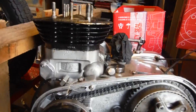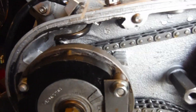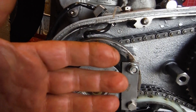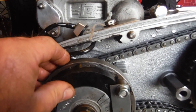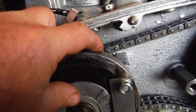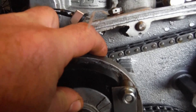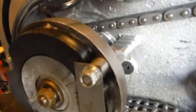You can probably see I've got the crank slid over closest to me, and I'm going to try and demonstrate the end float that we've got. Watch the alternator rotor and the stator — if I press on my thumb, that's gone in.